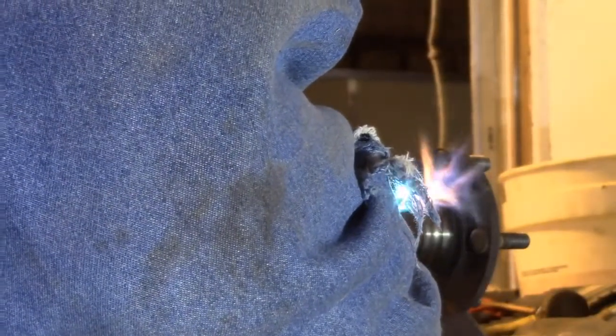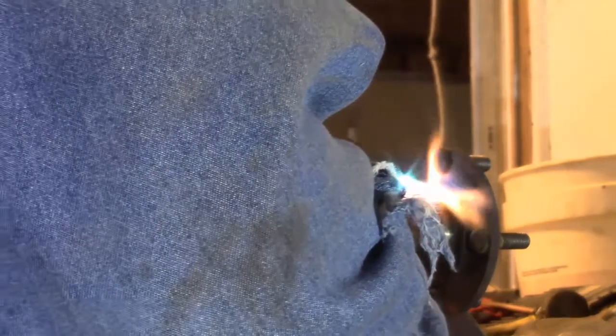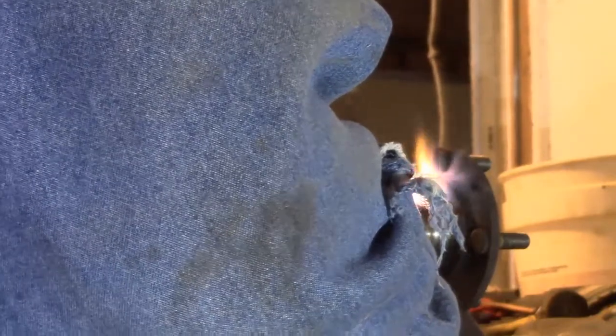It's not as hard as it looks, because even though these pieces of metal are actually touching each other with very small tolerance, the heat does not totally transfer to the hub itself. So you can just kind of peck away at this race and not have to worry too much about damaging your hub — as long as you're careful.